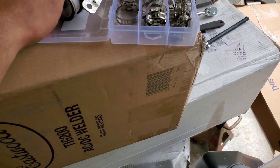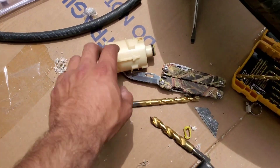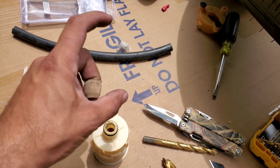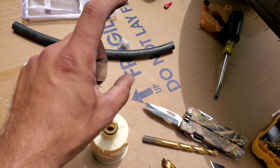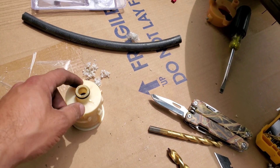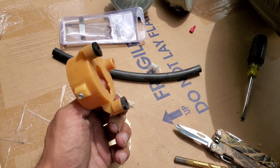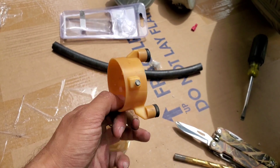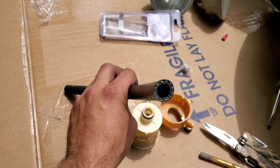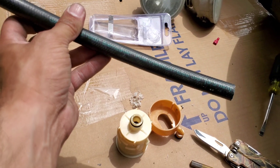This is my second one — I thought the filter might have been clogged so I built the whole sending unit again. Took this out — this was like a breather vent but I took it off so it could vent properly. I bought an external vent that's mounted to the top of the fuel hat from Summit — it was like nine dollars. It'll let air in and out but no fuel comes out. I removed the fuel sender, didn't need it, and put the fuel pump sock filter on — and that worked. I used three-eighths fuel line for the supply.